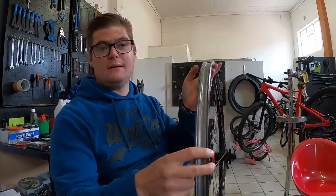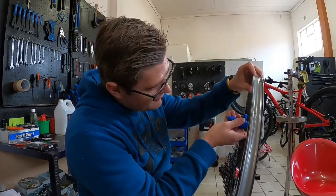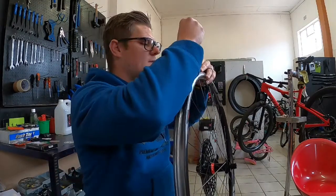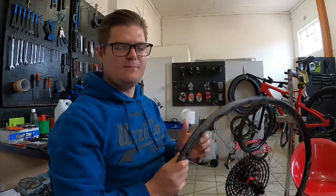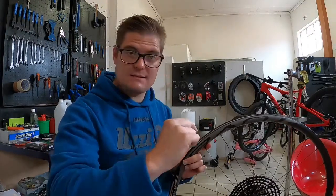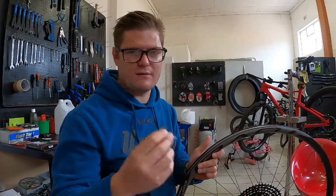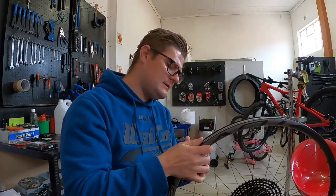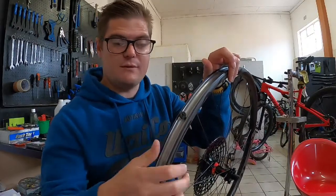I've applied the duct tape or alternative tubeless tape onto the rim. Now I'm going to take a small allen key and mark exactly where I need to make my hole for the valve, then give it a small bump through from the top. The reason I'm not using the valve itself to make the hole is that it can tear the tape around the valve hole, ruining the seal. I've also had cases where it bends the valve core. I've got a nice tight hole — putting the valve through gives a good seal.